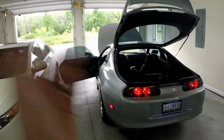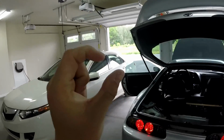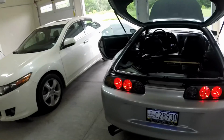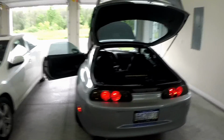Jake Dorsey, buddy, this won't be for you. For yours, all you need to do is go underneath. There is a 10 amp fuse under there. You just need to replace it. That's all, because your taillights are completely out. If you just replace that, that'll fix your issue. Mine is totally different. Wish mine was as easy as yours, buddy.